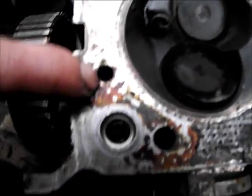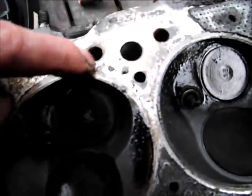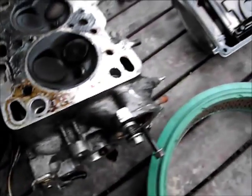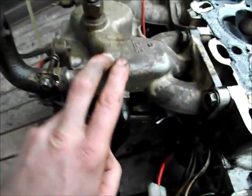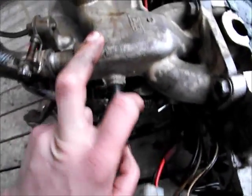Mazda B-series engine — look at that, there's no real corrosion around the water galleries. These are all water galleries, there's minimal corrosion around there, so these cylinder heads don't corrode. I don't know what the hell Mazda used to put this head on, but I know for a fact it's never been off. I had to use a six-foot bar to lever this cylinder head off — you can see where I was levering it, and I ended up using the manifold to lift it off. It was well and truly glued on.